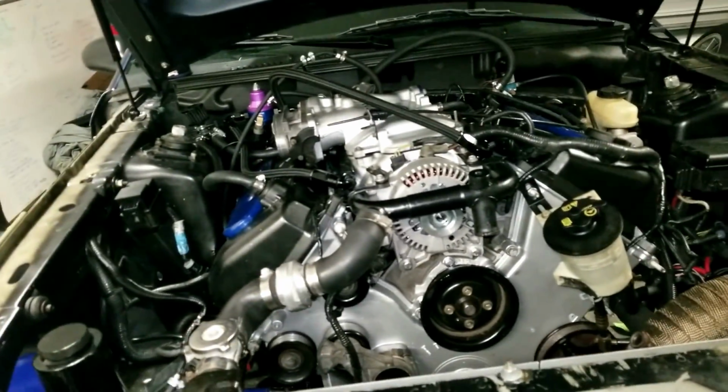I did go out and buy 30 quarts of oil so we can flush this whole system 2 or 3 times, which kind of stunk because that was a little bit expensive. Otherwise, we'll polish this off tomorrow. We threw the gasket on with the RTV, so that'll heat up and it'll be good for tomorrow. I'm gonna turn it over tomorrow, let it run for about 10-15 minutes, flush it, do it again, do it one more time, and then throw some good oil in there and a good filter, and then we should be straight. So I guess we'll see you tomorrow morning. Peace.